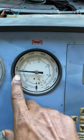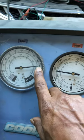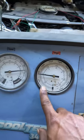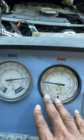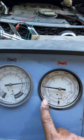First thing I do is hook up the gauges. When I hook up the gauges, the high side is almost 150 psi — this is with the vehicle on. The low side is almost matching. So what that tells me is this system is not empty; it is charged enough where it should be turning on the AC compressor. But I don't hear it clicking, so something else is going on.